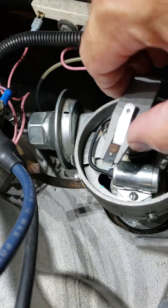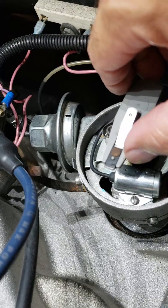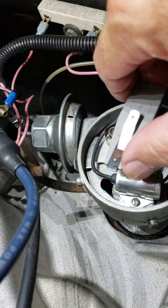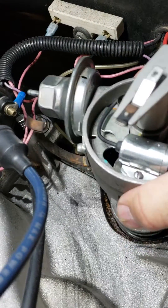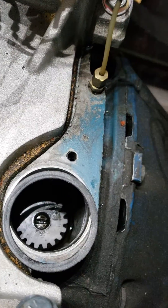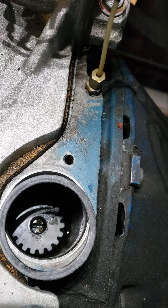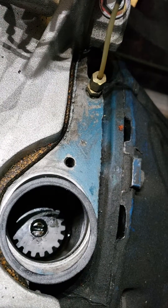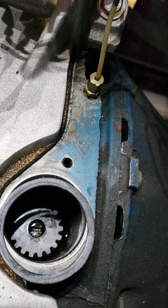This I believe is the loose fit between the oil pump drive shaft and the distributor. You can see down in the hole — that shaft is the slot in the shaft. It doesn't look good, and I think this is my problem with the ignition breaking up at high RPM.